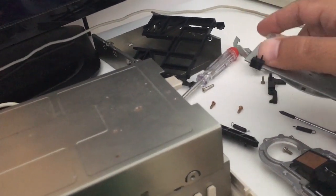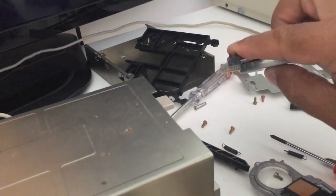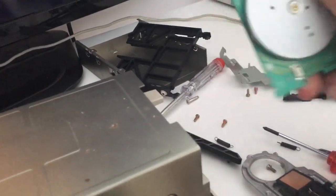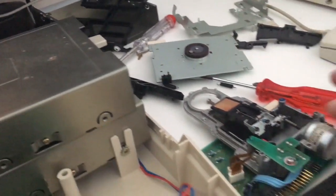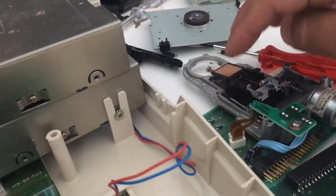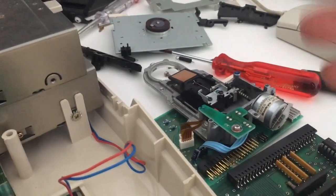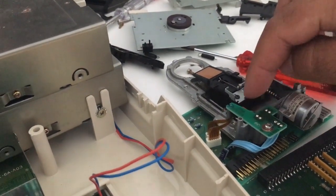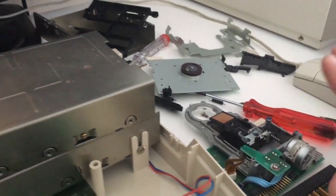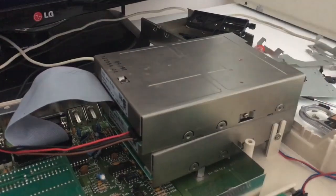If you have any idea of any company that sells these parts, I have never seen them. But if you know a company or a private person that sells these, please send me a link. As of right now this drive head is dead, and I've tried adjusting and cleaning everything — you can unscrew these two screws, adjust the head, clean it and all that — but it just does not work. You can still use some parts though: the opto sensor that stops the drive, and the stepper that makes the drive head go back and forth. Just don't throw any Amiga parts out, guys — they're 30 years old. I got a working drive now and it's great.